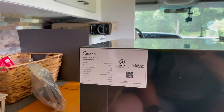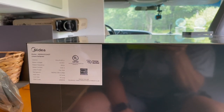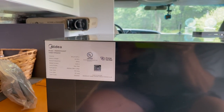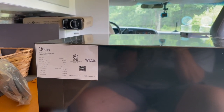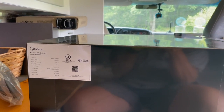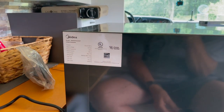We're going to plug it in using 110-volt shore power to cool it down — that won't affect the batteries at all. Once it's cooled down, we'll start our test. One important thing to remember: these units need to sit upright for several hours after you receive them, because shipping them on their side pushes the compressor oil out of place and can cause damage. We've had this sitting for about six hours, so we should be safe.